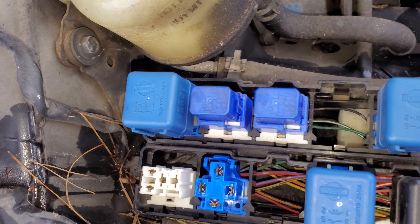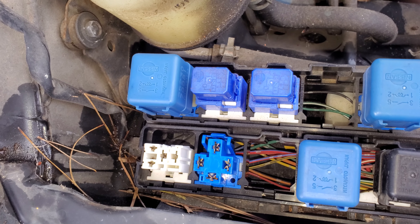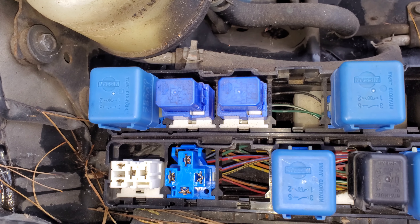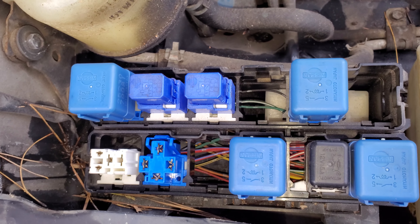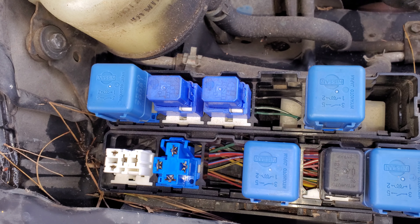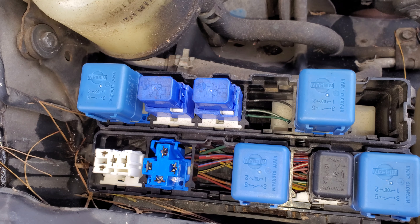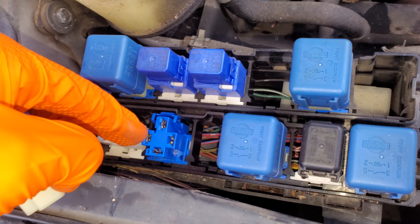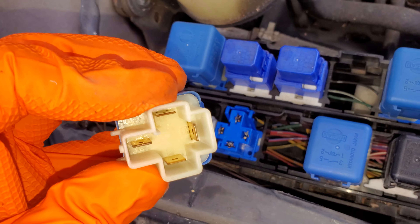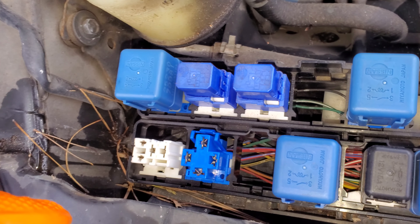Now while we're here, I'll point out to you the pins and what each one does. The 10 amp fuse provides constant power to the relay, and that comes in at pin one and at pin three. So both of those pins should always be hot. Pin one and pin three — those are going to be these two pins right there, and those two are always hot. One and three always get power from that 10 amp fuse.